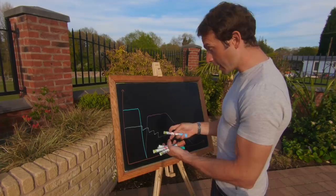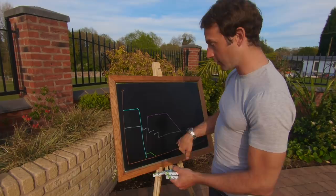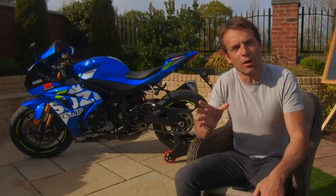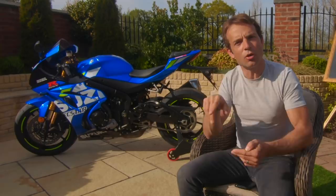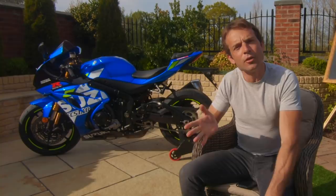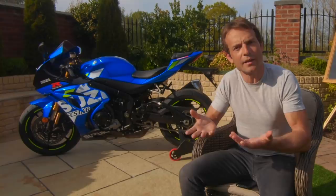The rear brake for most riders is applied briefly at the start of the braking phase and then released. At that moment, the leg comes out — say it's a right-hand corner, the leg dangles. From that point, the engine brake strategy takes over. When engine brake kicks in, it slows the rear wheel a lot, creating what's called rear wheel slip — basically the opposite of a power slide. The rear is slipping negatively, going much lower than the front wheel. The rear brake isn't really needed at that stage and can cause problems like locking the rear wheel, since there isn't much contact on the rear. That's why many riders do the leg dangle — the engine brake is already acting as a rear brake.